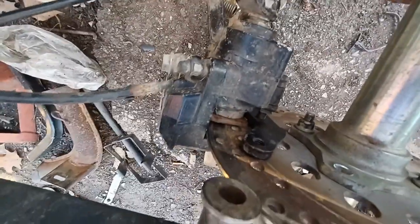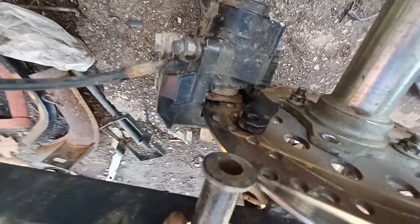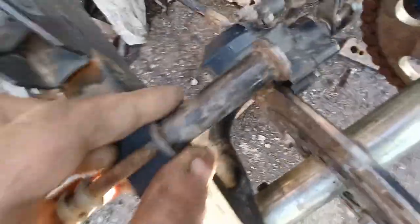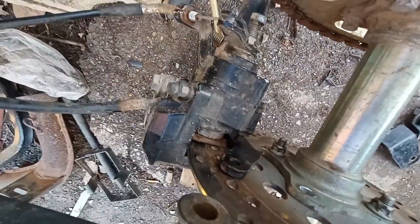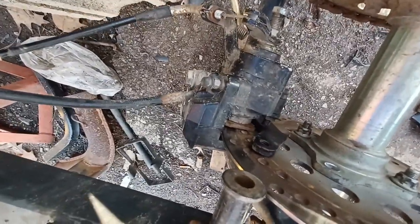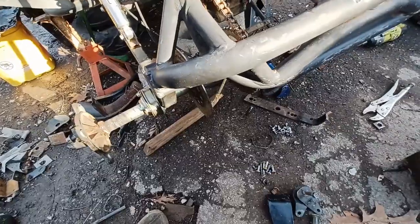It would hold the brake caliper from getting ripped off and keep it from rocking back and forth. So I figured that part out — I'm welding this tab with an additional mounting tab facing downwards so that way it can be bolted on. It's also threaded, so it'll work out. They used that short hex bolt over here when it was on that side, so it should do just fine over here.